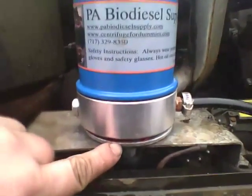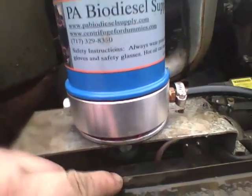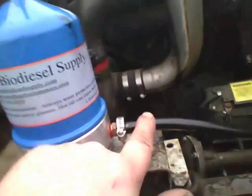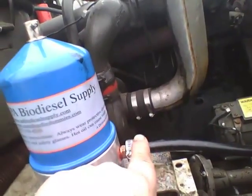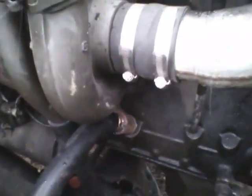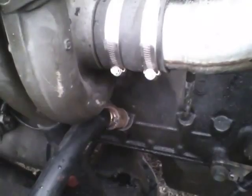And as you can see, I used a 1-inch floor plate for a fuel tank, and there's where your feeder line is. I mean, your drain back down here, and then there's your feeder line for your oil pressure to get the centrifuge to operate. As you can see, there's a T that goes down into the block, and this is gravity drained, of course. So I'll try to get as best I can with what I got underneath there.